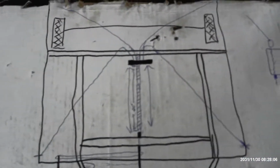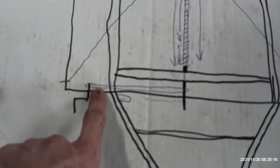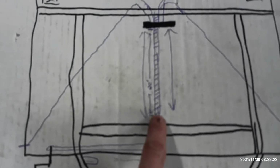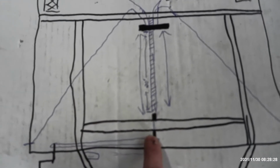So like I said, here's what's going on in a diagram. Here's your tires, your axles, the front of the camper. So you have your crank assembly here that you actually crank, and there's a chain drive down to the center Whiffle tree. And you have 20 inches of pull on that piece of all thread, the Whiffle tree. So the crank assembly only has to pull 20 inches.